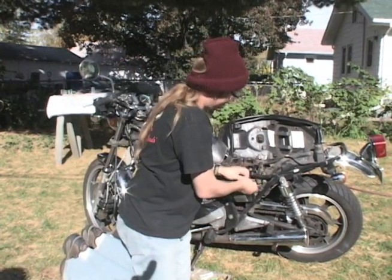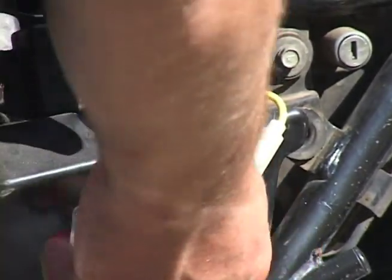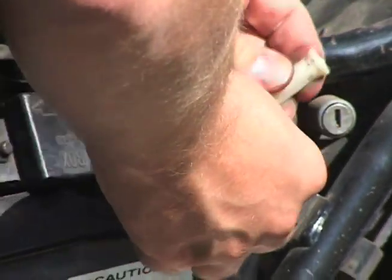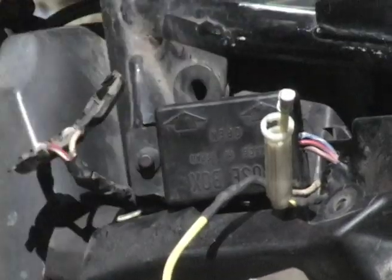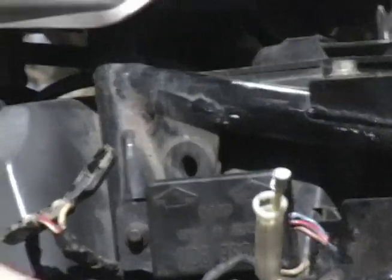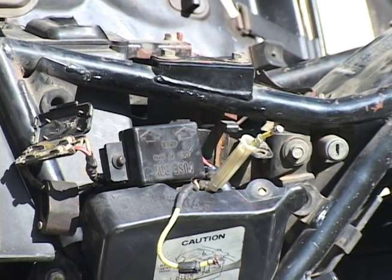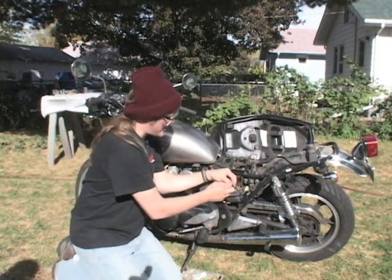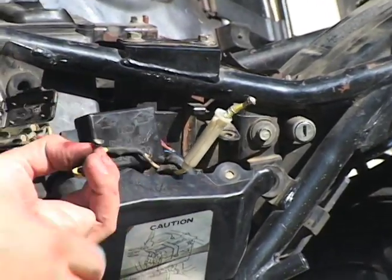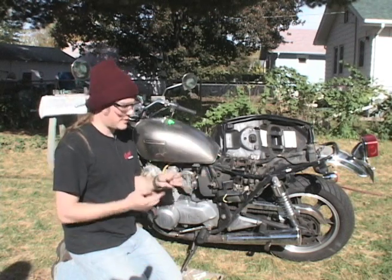The most common reason for a blown fuse is that a wire was bare someplace and touched the frame. Let's look at the main fuse — this replacement here. The fuse itself looks pretty good, not perfect. The two contacts are both pretty good, not perfect. But this is the main fuse — we don't want to leave this thing neglected, so I'm going to polish everything important about it. You notice the inline fuse holder: you can usually push the wires right out to get to those things. Look at that — nice mirror shiny. That's what you want: mirror shiny, really shiny. Be fussy about electrical contacts.